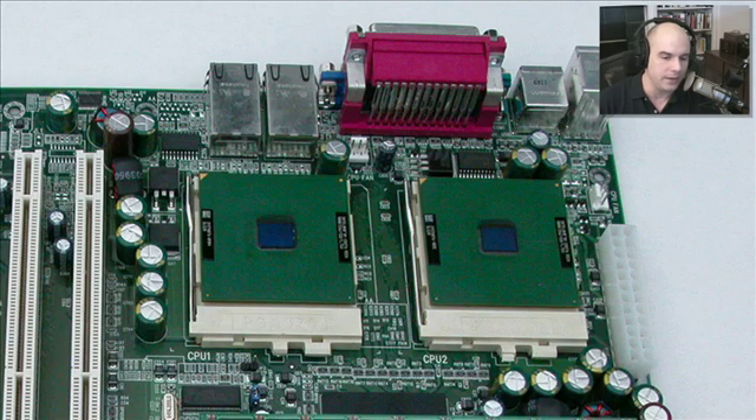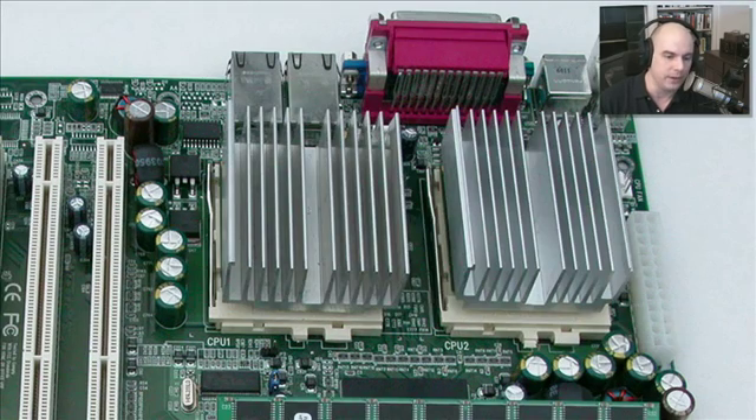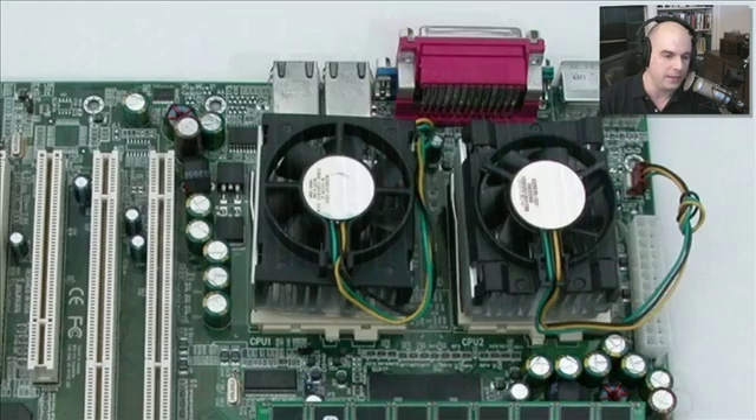Here are my CPUs without any type of cooling on them whatsoever — there are two CPUs in this particular server motherboard. I've purchased a fan assembly from a third party that comes with heat sinks, fans, and some thermal paste — this white paste. What you want to do is put that paste on the bottom of your heat sink, and the heat sink fastens right on top of those CPUs. You want to make sure you've got a good connection between that chip and that heat sink, and that's what the thermal paste is for.